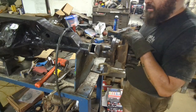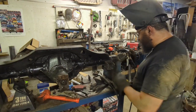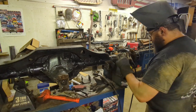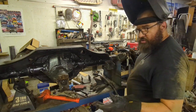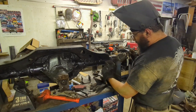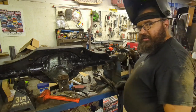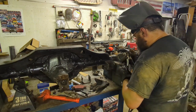This is getting really late but I really wanted to get this done, so I am tacking on - actually I'm probably just gonna fully weld at least this side's lower control arm mount. I built this, made a template, cut it out with a plasma cutter. Lower control arm mount - I'm running the bolt holes parallel with the bottom of the axle tube to get me as much link separation as I can. I'm a little bit short with my short truss so I wanted to push this down just a little bit lower than what I have now to make sure I have good link separation. Let's get this thing burned in.